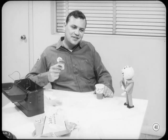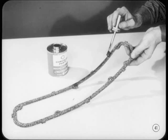Should the oil pan or valve cover gaskets be cemented in place before installation? They don't need to be cemented, Charlie. And don't you ever use shellac on any of our gaskets. Right, Tech. Put a thin film of Chrysler Parts Division's Perfect Seal sealing compound on both sides of the gasket, and then put the gasket in place on the cover.